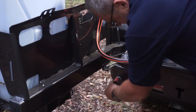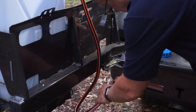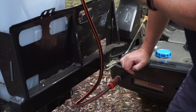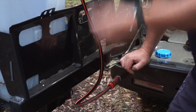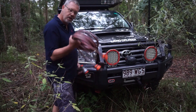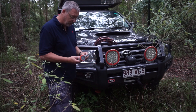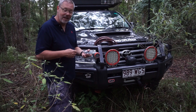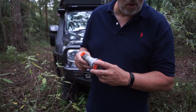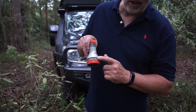I've got a little suction hose coming out the back of the truck — that just plugs straight in there. That line is plumbed all the way up to the front of the truck where the water pump is located. Up at the front end of the truck, we've got our delivery or pressure hose, and what I've got as a shower hose is just one of these cheap garden nozzles that everybody has at home. It's got different settings on it, and the one most important from a remote area travel and water conservation perspective is this one called mist.